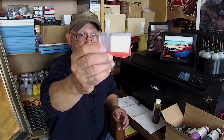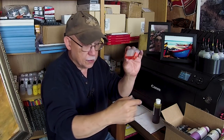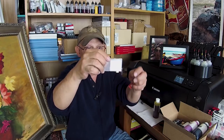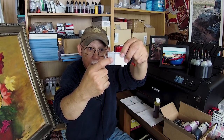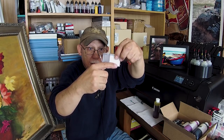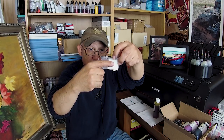What we want is a cartridge that is nice and pristine white. I've got the good clips on — some cartridges have the original clip, in which case you need a rubber band to keep it in place, but you must have this on. Do not attempt to refill with the clip removed or you'll have ink all over the place. At the joint between the wall separating the sponge side and the liquid reservoir there is a small hole at the very base — that's where the ink enters.